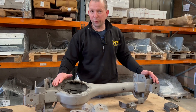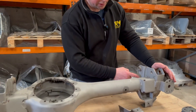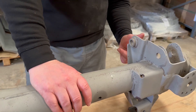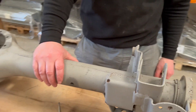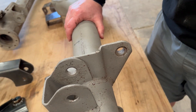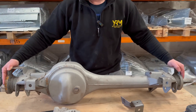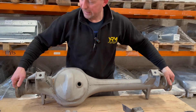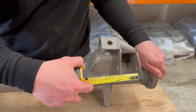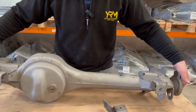This is the 2002 onwards axle. You can see how the anti-roll bar — what we were just talking about — is fitted there. It's got a weld round; it's been welded from this side here. What makes this a 2002 onwards one is the radius arm being 54mm, so that would be from 1994 onwards. What specifically makes this 2002 onwards is your Panhard bracket.